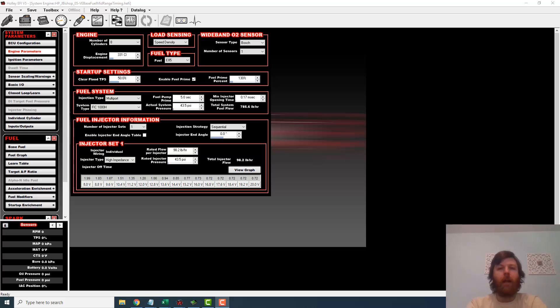What Jesse's talking about is actually the injectors putting out what's called a priming pulse. The idea is that you know how much fuel your car needs to start generally — a certain pulse width — and it'll keep injecting that throughout the cranking cycle until it catches. But the priming pulse is a special single pulse in each injector right when you start cranking, so it dumps extra fuel to wet the runners and help the engine start a little bit quicker.